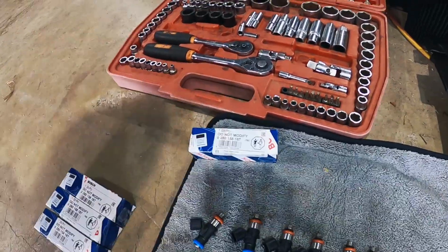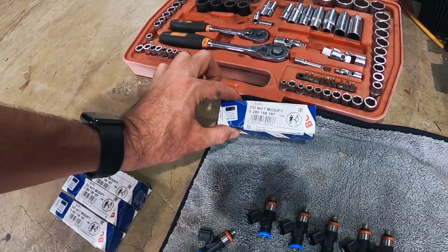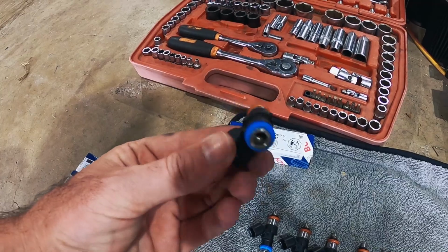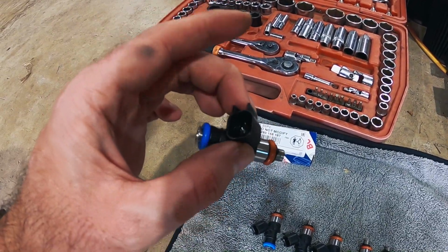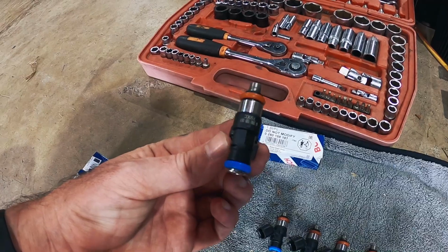But because of the way I'm running this car, it's going to be fighting 20 psi of air pressure on the other side of the injector. So essentially they will be working at around that 40 psi. But unfortunately, these are not designed to be pressurized past 40 psi. So basically they'll be fine for a naturally aspirated setup, but when you're trying to offset boost pressures, when you're not on boost, they weep.